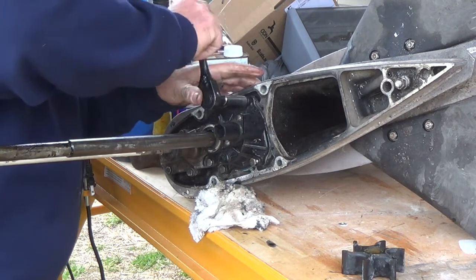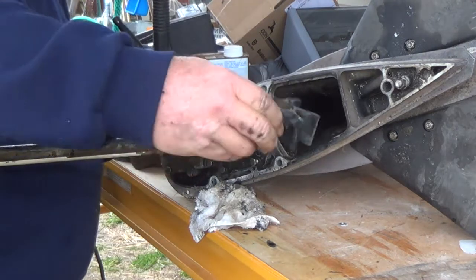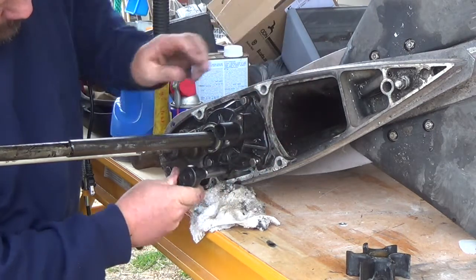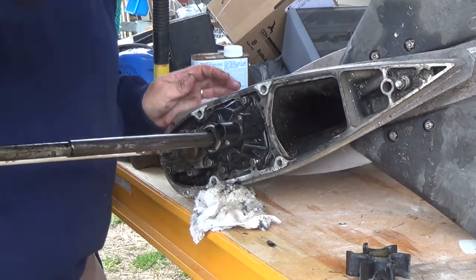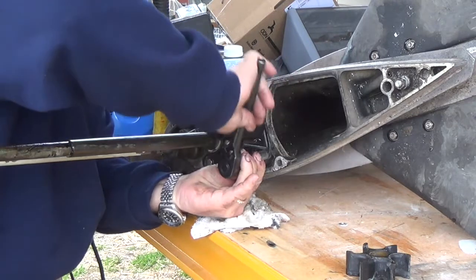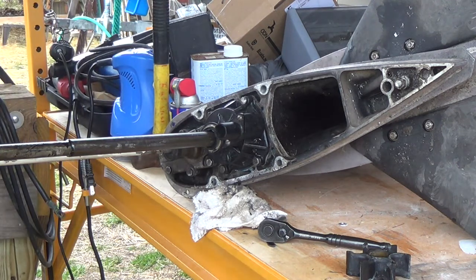I'm just snugging this up. There was probably nothing wrong with that impeller, but I just thought, you know, for the amount of money we're talking, it was better to change it. But I've discovered that the seal was leaking, or the seal was getting ready to go bad, so it was well worth it. We won't be putting this back on today, but we got a little bit done before I'm ready to take the big boat out.